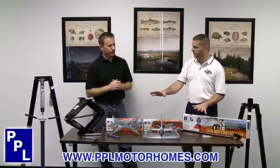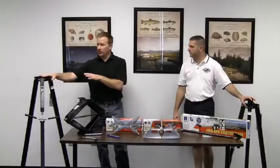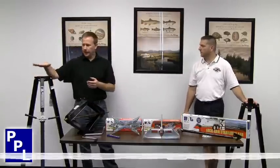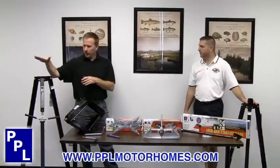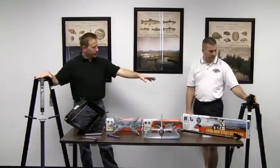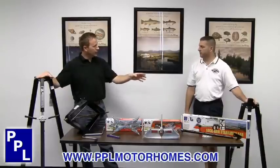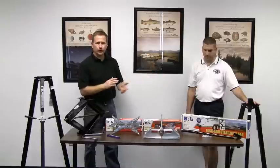All of these products are mainly for travel trailers and fifth wheels both. But you also have the tripod stabilizers that are for fifth wheels only. For fifth wheel campers only, we do have a two-legged bipod model, but our tripod is our most popular seller. This is for the pin box that attaches to the hitch of the truck — it helps stabilize that while there's movement in the trailer and keeps that cantilever action from happening. You snug it up and we have adjustments to tighten it and spread the legs apart. The gooseneck version is for race car trailers, horse trailers, or living quarter trailers with a gooseneck on the front, or consumers that have converted a fifth wheel with a fifth wheel gooseneck converter — they have a little brother version to use there.